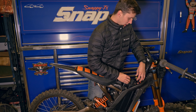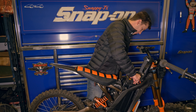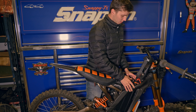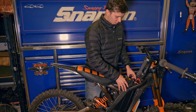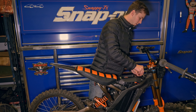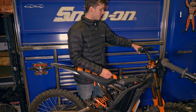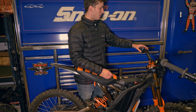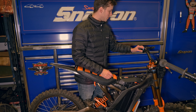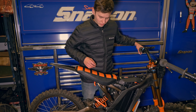Drop the battery back in the bike, plug it in, flip the breaker, and close it up. We have our controller set up so that sport mode on power level 9 will draw 7,000 watts.